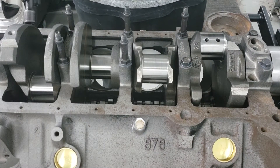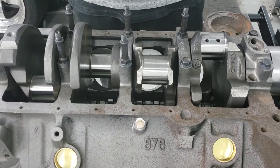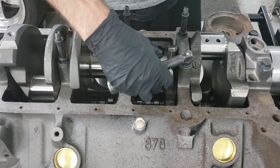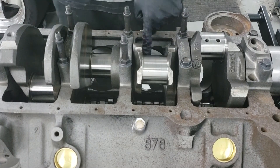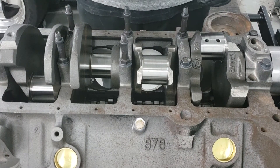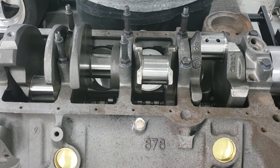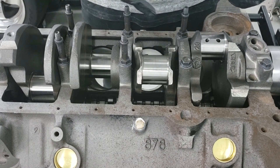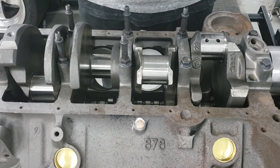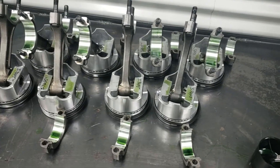Now that you've got the crank put in, we're just going to go ahead and rotate it a little bit to make sure that it moves smoothly. While we're here, we're also going to line up one of these journals with the center line of one of these bores — this will be the very first piston that we're going to slide in. The reason is we want to rotate this assembly as little as possible, because every time you rotate it you're basically wiping out the pre-assembly lubricant you put on your bearings. In the next video we're going to continue our assembly starting off with the pistons, piston rings and rods.